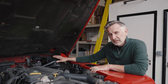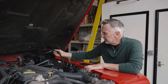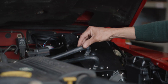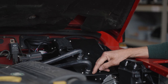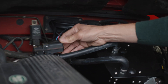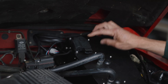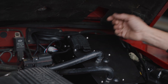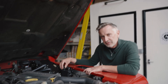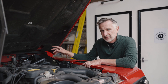The unit is now installed in the car. It's fitted up and wired up, albeit with some rather development-looking harnesses. We have hot water providing the heater matrix with coolant, so this is getting hot. We have a servo-controlled water valve which can switch the heat feed off when the AC is on. We have a servo flap which controls our temperature blending, and we have our ECU — common to other projects like the 911, but with slightly different software — which controls all the functions in the heating and AC system.